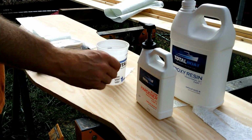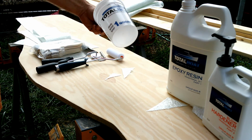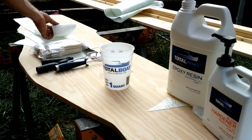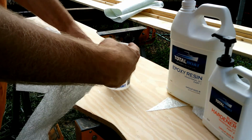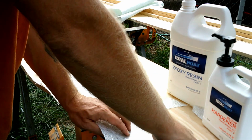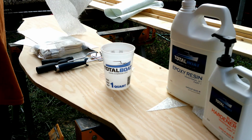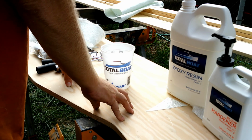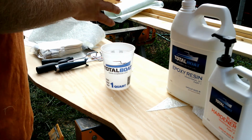Alright, so I got this epoxy off from Amazon. I'm not sponsored by anything, as you can see by my 6 subscribers. I'm just going to put some of these strips inside the boat over there. We're going to put them here to lock in the first set, and then we'll put a layer of fiberglass on this piece of wood, and then we'll take that over to the boat and we'll clamp it all together.